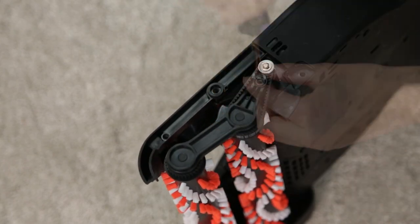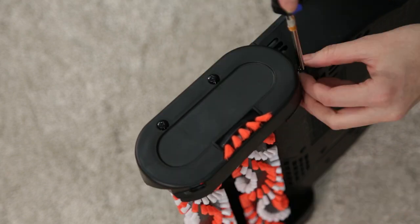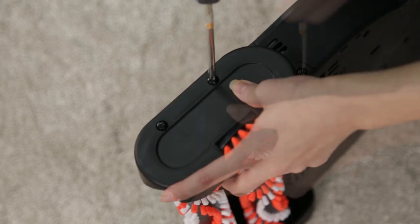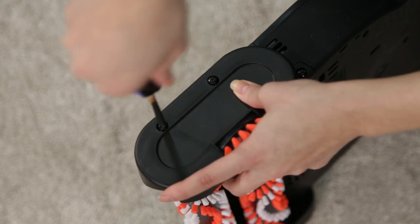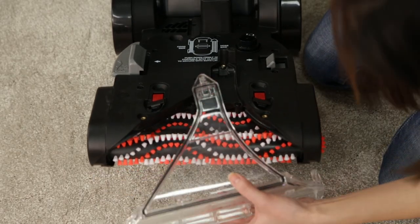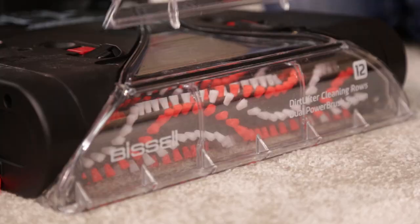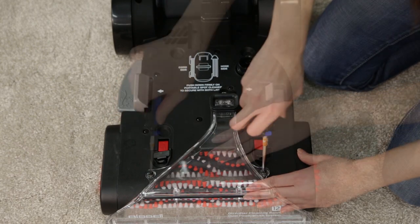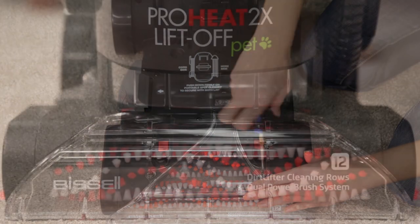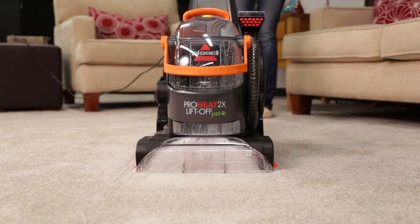Return the pivot arm with one screw, and the end cap with three screws. Set the machine upright and hook the nozzle into the black end caps. Secure with three screws. Now that your belt and brush rolls are replaced, you are ready to clean.